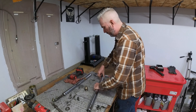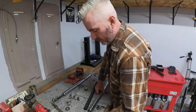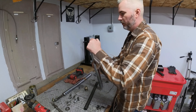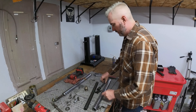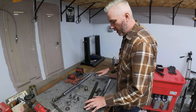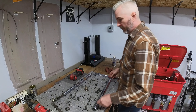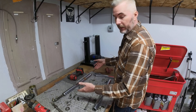As you can see, these are under a lot of pressure. I can remove my spring — the spring is covered in oil, of course. From there I can pull the bottom of the damper tube and push my damper all the way out. There I have my damper — all these parts need to get washed. I'm going to put these in the parts washer, wash everything up, get the oil cleaned off of them, and have them ready to be reinstalled. We just need to repeat the process on the other tube and then the tubes are ready to go.